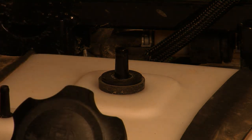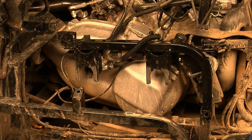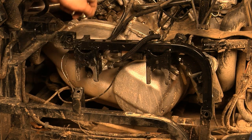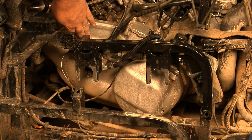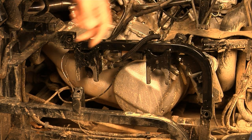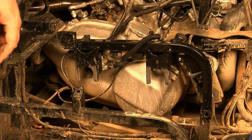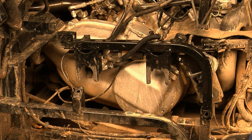Now we're going to remove the tank. You can slide it a little bit forward and then just take it right out. Now you can see the CVT cover itself down here — this is it. Your drive pulley and your driven pulley are under here. It's got an intake that goes up to here and gets its air from right in front of the nose piece. On the rear of the CVT there's an outlet for the air that goes down and will bubble underwater — there's a trap there to make sure water doesn't get in.